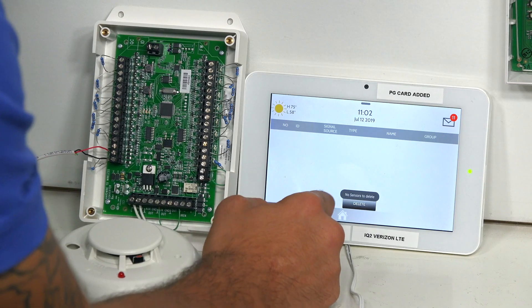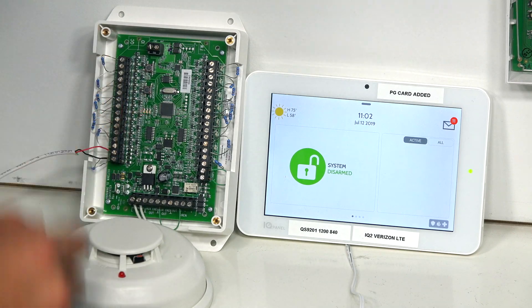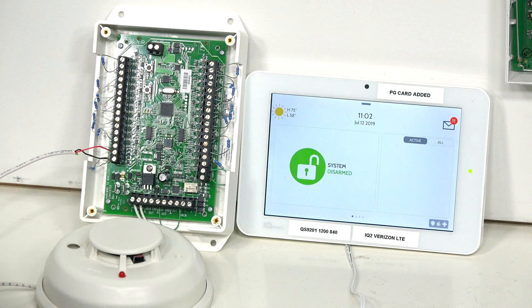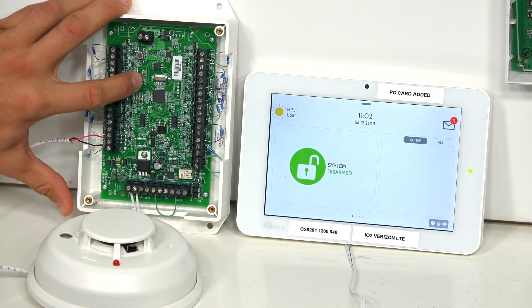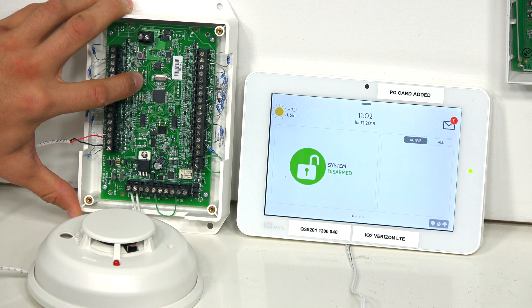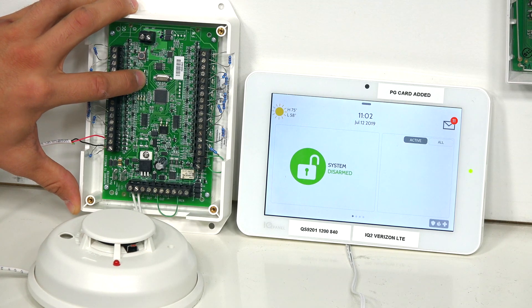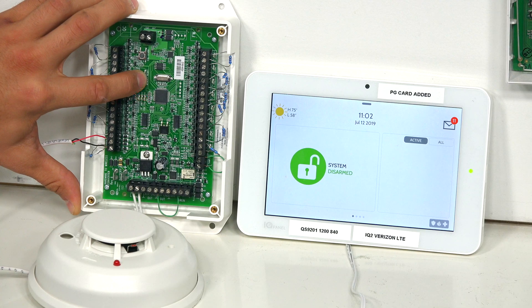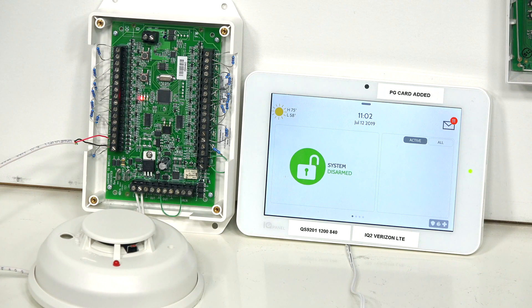On my hardwired translator, I'm going to unplug it. What you have to do is hold down the memory reset button and keep it held down for three seconds while you reapply power. You're going to see these three little LEDs down here flash a whole bunch when you've done this. That flashing tells us that we've just reset the memory on our 16F, and we're ready to re-enroll everything to the system.